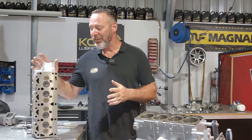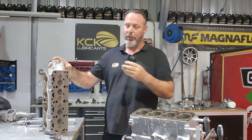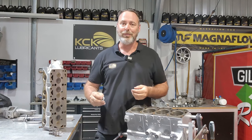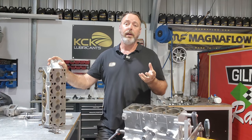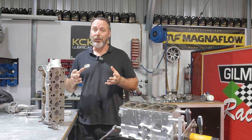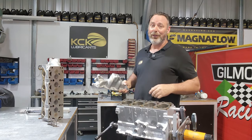We have the proper cylinder head for this engine - one of our old race cylinder heads that we've had reconditioned. It's cast iron with the proper springs, proper valves, and the legal porting requirements. The correct throat sizes, correct seats - the cylinder head that should be on a Formula Ford car. Valve springs are a little bit heavier than standard, sitting in aluminium spacers to stop them jumping around. The valve stems have been machined for positive valve stem seals unlike the umbrella type from factory. This has got plenty of meat left on the surface. Best part - we have the matching intake manifold, already port matched to suit this cylinder head. We can just drop this on and bolt it up.